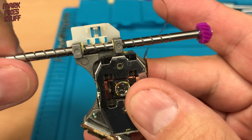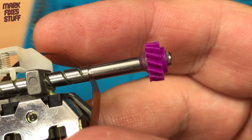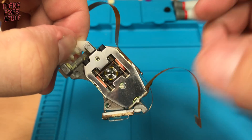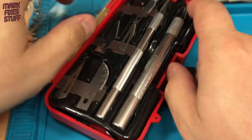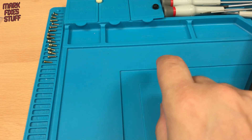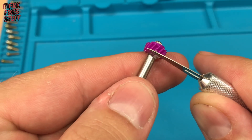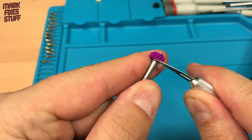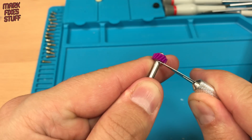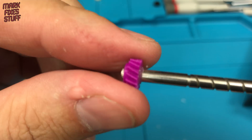The gear seems really central as well. One potential problem I spot is that there's excess resin where the gear is mated to the shaft. I decide to remove the whole shaft and remove the excess. This is done by pulling back the gear teeth as shown. Scalpel please, matron. As I gently whittle away the protruding resin, you can see just how hard it became during the night. I don't need to remove it all because there is a gap between the gear and the shaft holder. There, that's close enough.